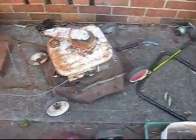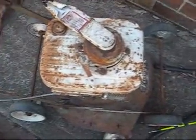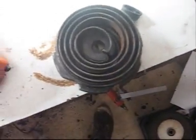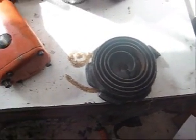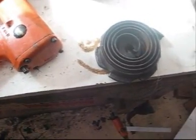And I fixed the wind-up mechanism on this one. I'll show you what was wrong with it. I had a spare which I had to use a part of. So this is the wind-up thingy here. It's a bit hard to explain, but the little ratchet mechanism that hooks into here had broken off, so I got another ratchet mechanism off another one of those stubs, which is pretty similar, and put it on, and that fixed that up. And it doesn't have a spark, so I might clean the points on it. If that doesn't fix it, I'll probably just sell it.